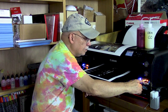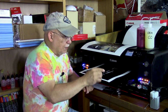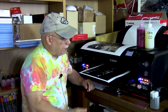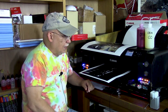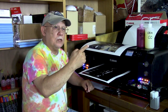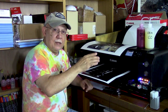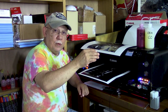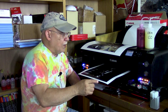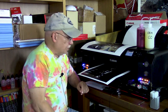I have found out that when you calibrate the sensor and do it while it is attached to a cartridge in the compartment, it has to be a cartridge you have filled with an exact amount of ink — in this case I began with 20 ml. As I was playing with the calibration I had to go counterclockwise half a turn, then proceeded slightly more and more until the lights flickered. At that point I went back and forth playing with it — you've got to use one of these little tiny screwdrivers. I got it to the point where if I just touched the cartridge and made it wiggle, the lights would go on and off.